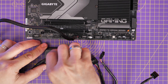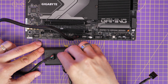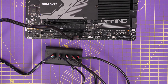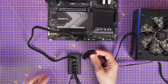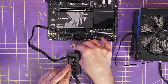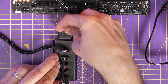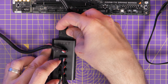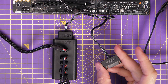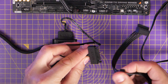You potentially have another spare USB header, as I will have on the Gigabyte motherboard, so it gives you flexibility to install a lot more. This is a reasonably affordable purchase, and I'll link to it in the description. It's fairly straightforward to install — it requires SATA power, so you need a connection to your power supply unit. Make sure you've got those cables available, because if you're installing multiple RGB controllers for multiple RGB fans, you're going to need power for that, power for the USB hub, and possibly power for your all-in-one cooler.